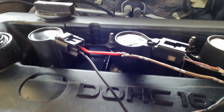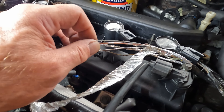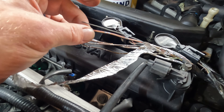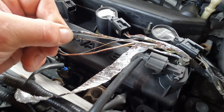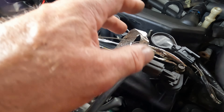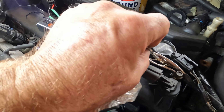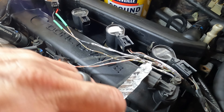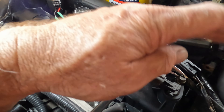We're going to do all of them like that. Got our heat shrink on here already — going to fit right over that. I unwound the shield off of this wire on our number two cylinder negative. This wire encapsulated with our ignition wire is our ground for the shield, so that has to stay there. It's kind of crusty but there's not much I can do about it. We're going to unwrap this, do our splicing, and then wrap the shield back around our new wires and press on to the next cylinder.